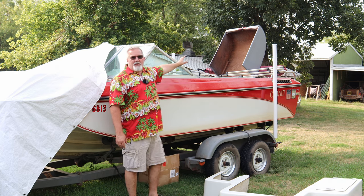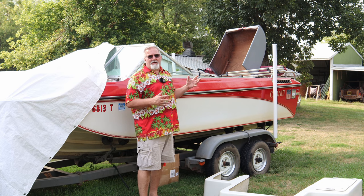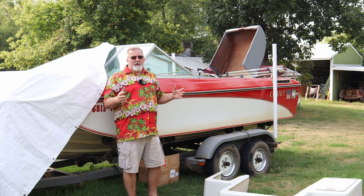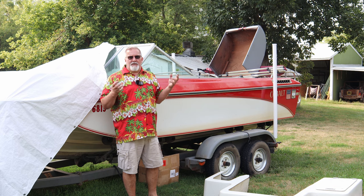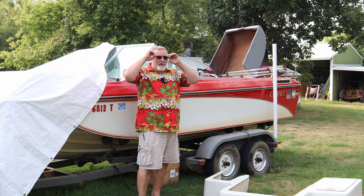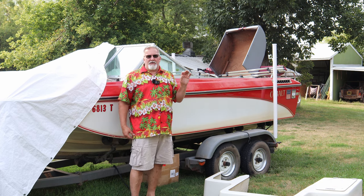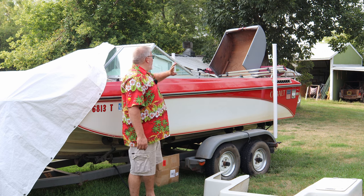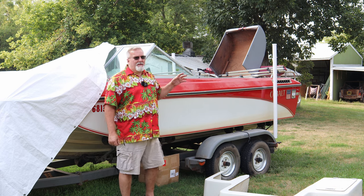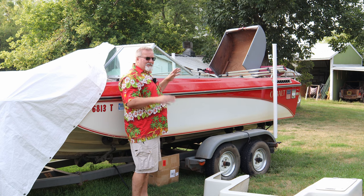The wood in that engine cover is 50 years old, and they put a minimal amount of support in there. So we're gonna go ahead and take that all the way off. We'll take it to the shop. I wanna cut some more strips of wood and glue it in, brace it up, make it just a little more solid than it is. You can sit on it and stuff, but it has a little springiness to it. I think if I put a couple of 2x2 stringers across, or even 1x2 stringers, I'll just rip cut some ply or some wood, and then I'm gonna support it, glue it, support it, let that dry, paint it with some indoor-outdoor paint, and then I'll put some sound deadening foam inside there just to quiet it down a little bit more.